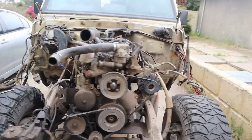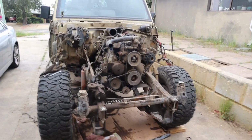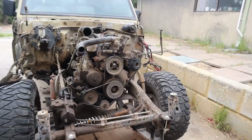All right, after hours and hours, it's ready to pull. Got all the wiring labeled, all the bolts and parts bagged and tagged. Everything's disconnected. We have dropped the crossmember, disconnected the front and rear tail shafts, and everything is disconnected from the gearbox, being supported by the jack. I'll lower that jack down, and I've just rolled out the engine crane. So we'll lower the jack, pick it out, drag it back and rest it down. It's just started to rain, but anyway, we progress.